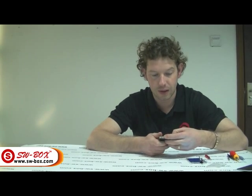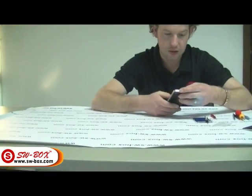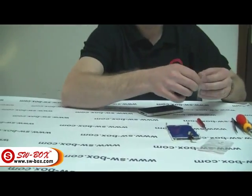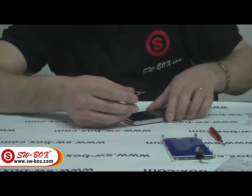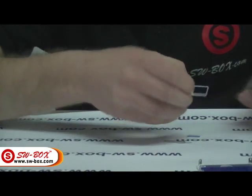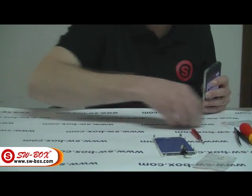It does take a little bit of time. First thing you need to do is turn your iPhone 4 off. Once that's come off, it's probably best to remove your SIM tray now, so we do that next — just pop that out and put it completely out of the way.